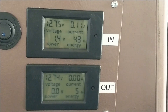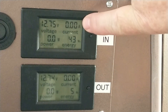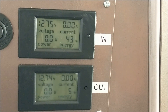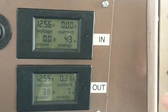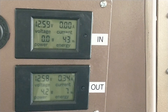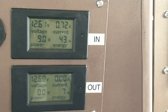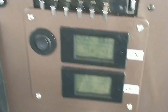I'm going to go unplug the shore power — watch this gauge. Okay, it went to 0, meaning we're not using any current at the moment; the batteries aren't charging or discharging. Now if I start the generator, you can see the voltage fluctuated a little bit and it's showing a little bit of usage on the current, but it's going to flip here in a second. There you go — it's now charging, but not charging very much, and these gauges help me troubleshoot this.